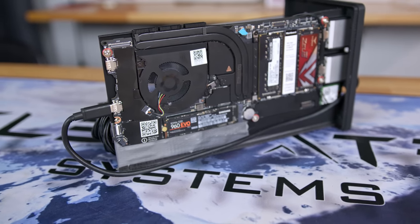Even this updated version is still a prototype. The Intel 1260P heats up to a whopping 100 degrees Celsius even under moderate load, and an entirely plastic case is not going to survive long. So while I intend to keep most of the casing 3D printed — likely using ASA filament — I'll definitely be replacing at least the internal tray sections with something more robust, like 14-gauge aluminum.